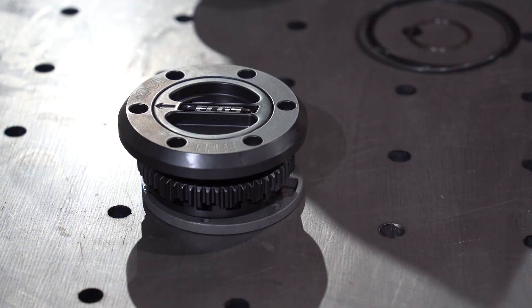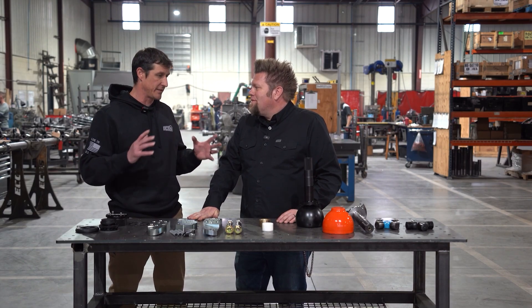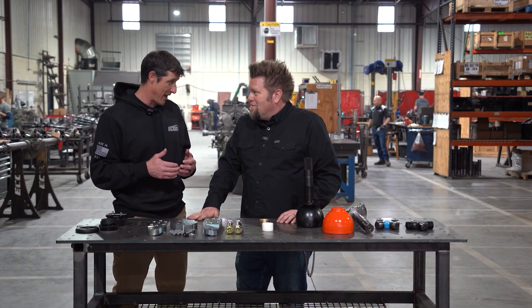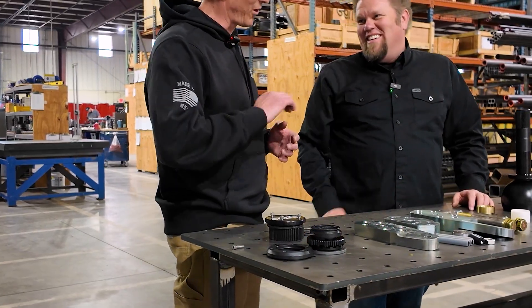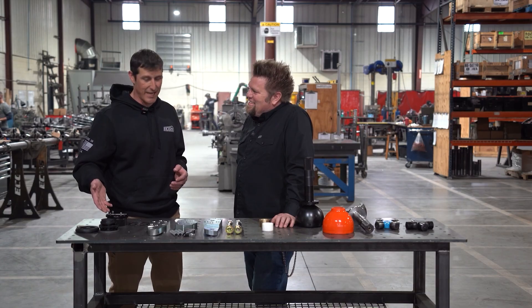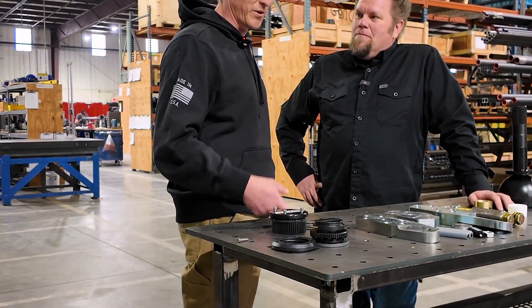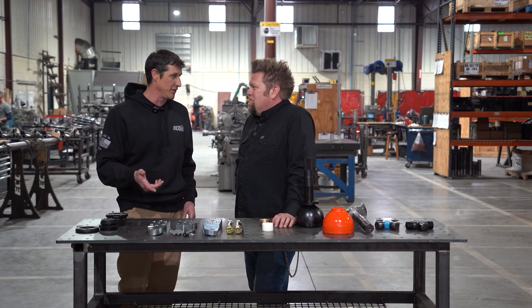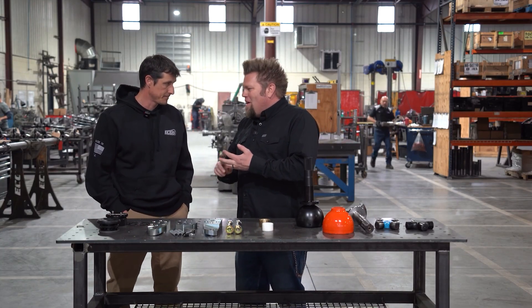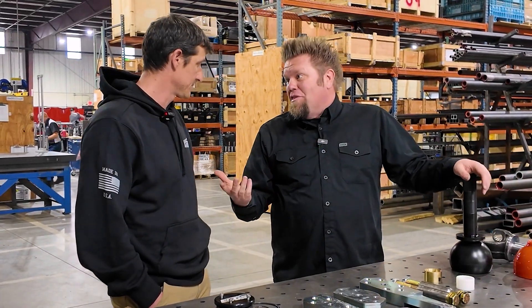With the lockout, I'm thinking about what's going to break. We build this thing and everything's breakable — somebody can break everything. So what do we want to break? My opinion has always been that I want the freewheel hub to break — that's been the easiest fix every day for 20 years. If I'm out on the trail and the lockout breaks, you take it apart and just order the pieces to put it back together. The other thing is I carry slugs with me: run lockouts, and if there's a failure in the lockout, you pop the slug in and use your brain the rest of the weekend. Because it's not just axle failures — if the transfer case or drive shaft breaks, being able to unlock that axle from the wheel means you can drive out without having to lay underneath the rig.